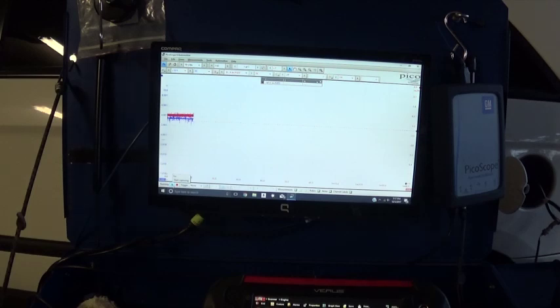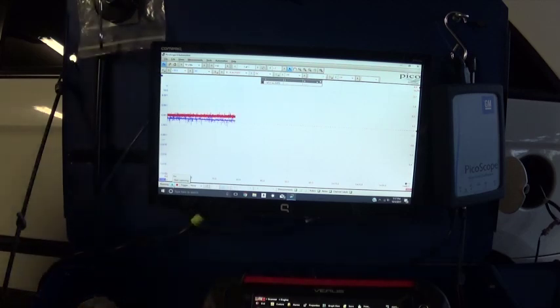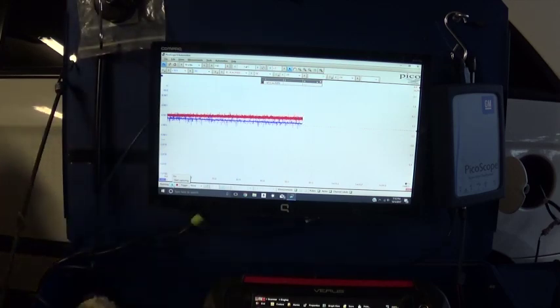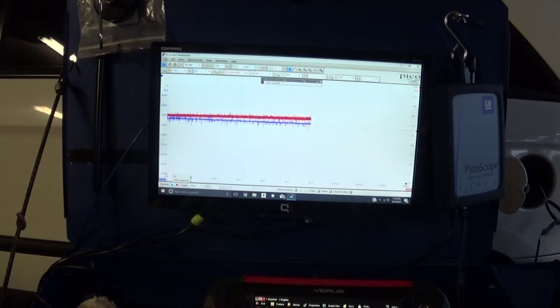So the next one I'm going to do, I'm going to pinch also my vent hose where my filter is down at the charcoal canister. If the ESIM switch is not sealing right, this integrated module is supposed to seal the system. I'm going to rule that out by pinching the vent hose to see if that's going to change anything. Bigger pliers. As you guys can see, I'm losing vacuum pretty fast actually.